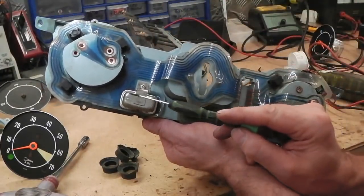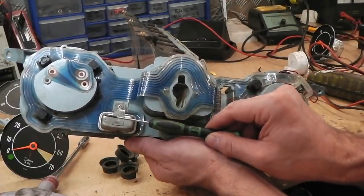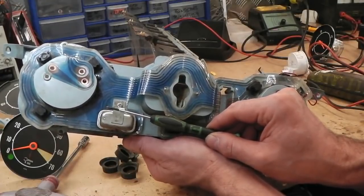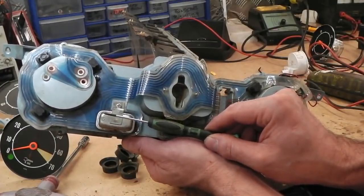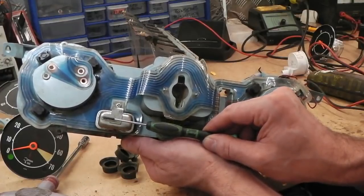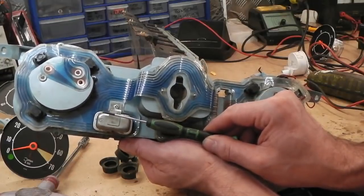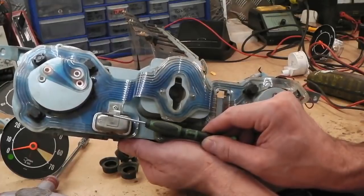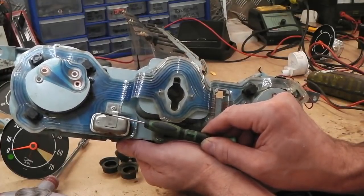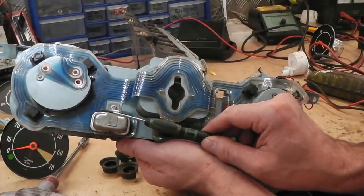There's one of them inside there with a little wire coil around that heats it up. As the wire coil heats it up, the metal bends and breaks the contact of the actual heating coil, so then it begins to get cold again, and because it's now contracting as it's cooling, it makes contact again with the heater coil, heats itself up, makes it bend, which then breaks the contact. So what you get inside here is off, on, off, on, as it heats up and cools down. It goes through its own little cycle, basically like a flasher unit almost.